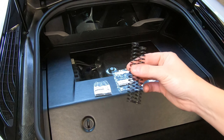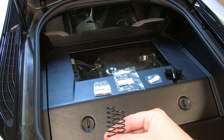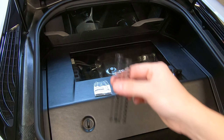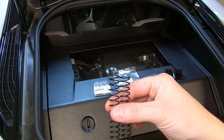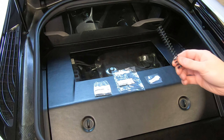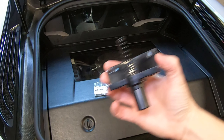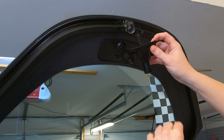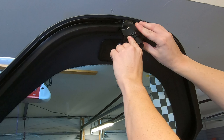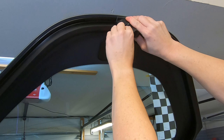Before I placed the new spring into the housing, I compared it to the old spring. The old spring is on the right — it's actually a few millimeters shorter than the new spring. So this may have been in the car since new. This is a 2015, and it's now 2019, so it's four years old. I think it was pretty much due for replacement. I'm going to take the replacement spring and place that right inside the pivot. So here we are — it's ready to go. I'm going to take my housing and insert the spring into the socket here and push it up into place.